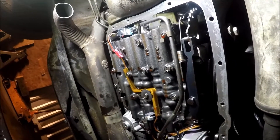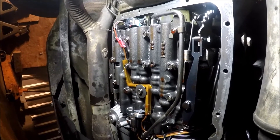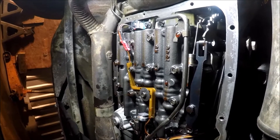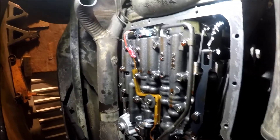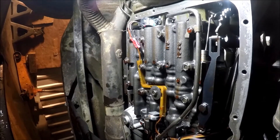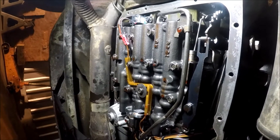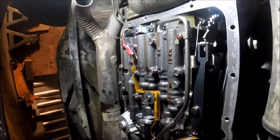The 1992 Chevy Suburban — 1992 was the last year of the 700R4. 1993 is when GM went to the 4L60E. So if you've got a '93 truck you're trying to swap the transmission on, it'd be '93 and '94. 1995 is a standalone year only. '96 and up, you can swap any transmission from '96 up through I believe '07 or '08 4L60E — they're all plug and play. This transmission here fits '87 to '92.